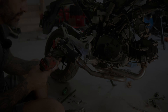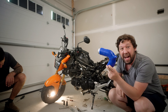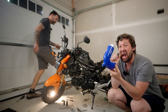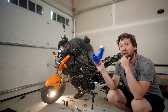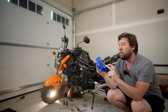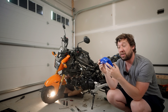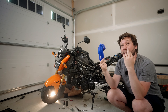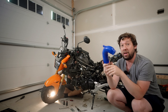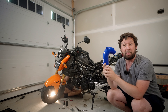So I screwed up. The Chimera intake that I ordered — it was an honest mistake — but this is for a 50 millimeter throttle body, which isn't a stock throttle body. That's why we were wondering why it wouldn't fit. So what we're going to do is put the stock air box back on so it'll run, and I'll catch you guys when the proper intake is on so we can see what the proper performance will be.